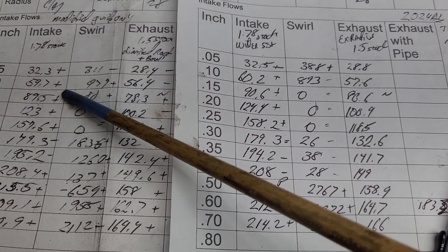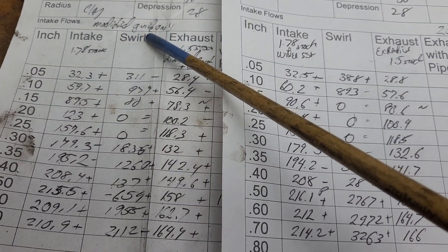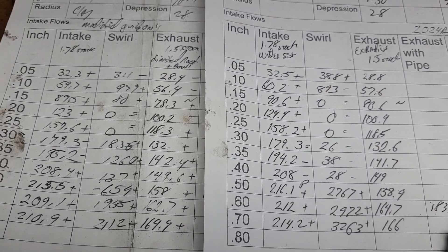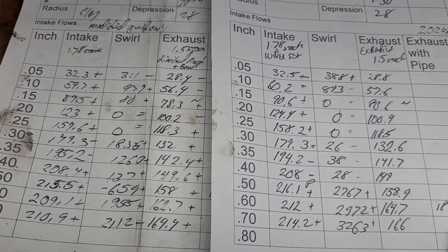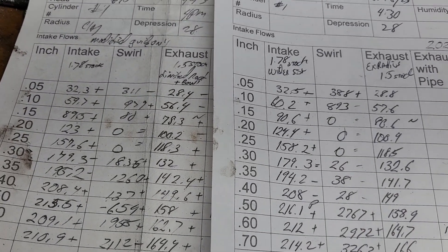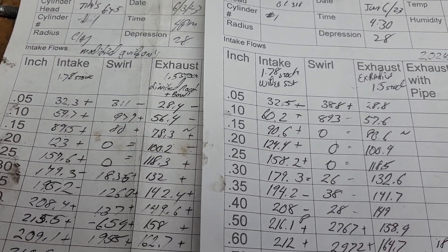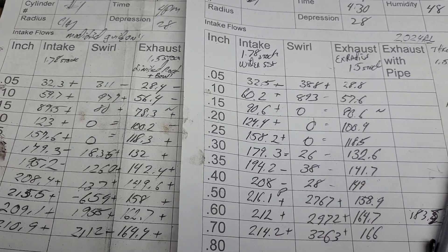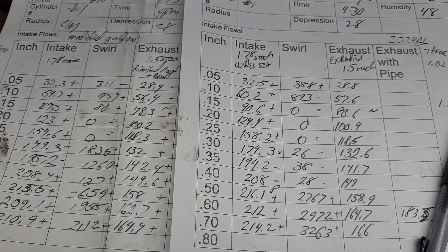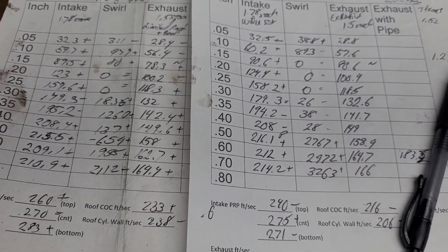Okay, this is our previous - this is where I necked the guide down quite a bit. And to be honest I'm not completely thrilled with that pointy guide. I may still round it. I did that on DV's cylinder head chunk. Not that it was a huge difference, but I like the rounded a little better because instead of telling the air where to go, it kind of lets the air go where it wants to go.